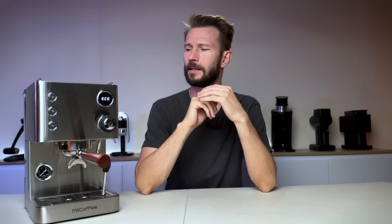If you're familiar with semi-automatic espresso machines the brewing process is pretty straightforward, but what's better here compared to the Gaggia or Rancilio machines is that it has a single boiler only for brewing. That means a lot more temperature stability, and you don't need to purge hot water as part of your routine. For me that's already enough to say I like this machine — temperature surfing and purging is just not fun in 2023.